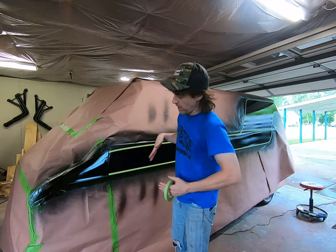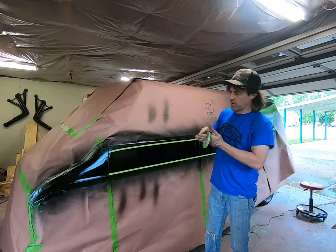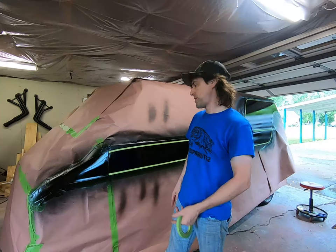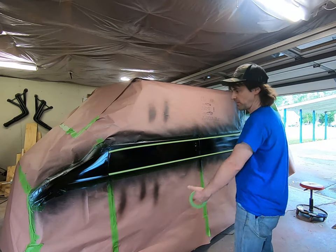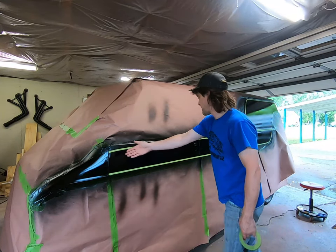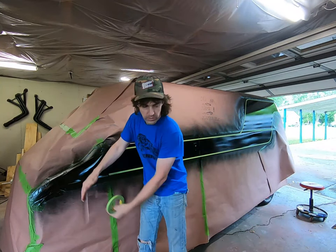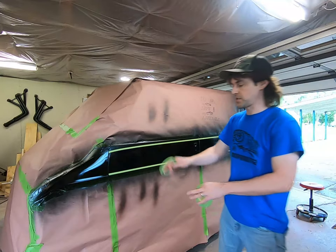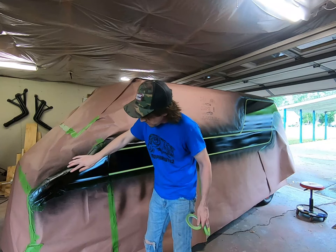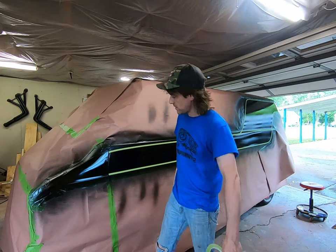I want the points up here where every color is starting, and it's all a real wisp, a little arrow-like deal. I want them to all be very present all the way up to the front. So to give the transition of motion, the idea of motion, I went ahead just from the door edge back and kept that at a half inch, right about here, and as I taper forward, I'm going to use our eighth inch tape, and we're going to come off of this one and just gradually taper it until it pinches up right next to the edge of this, okay?